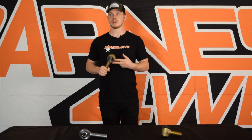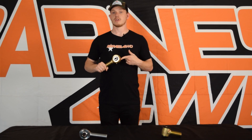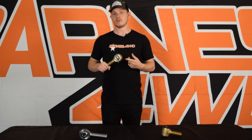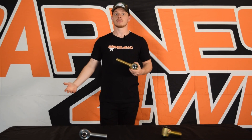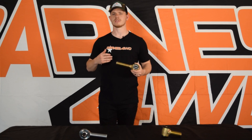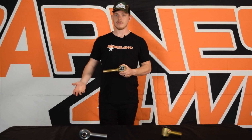These are greasable as well — there's a grease zerk right here, and the poly bushings have grease grooves to allow grease to go all the way around the spherical ball and keep everything nicely lubricated. We basically recommend these for people who drive their rig on the road a decent amount but also want to get into very technical trails — Moab, Johnson Valley, places where you're really pushing your rig to the limits. They offer vibration dampening on road or gravel roads as well.